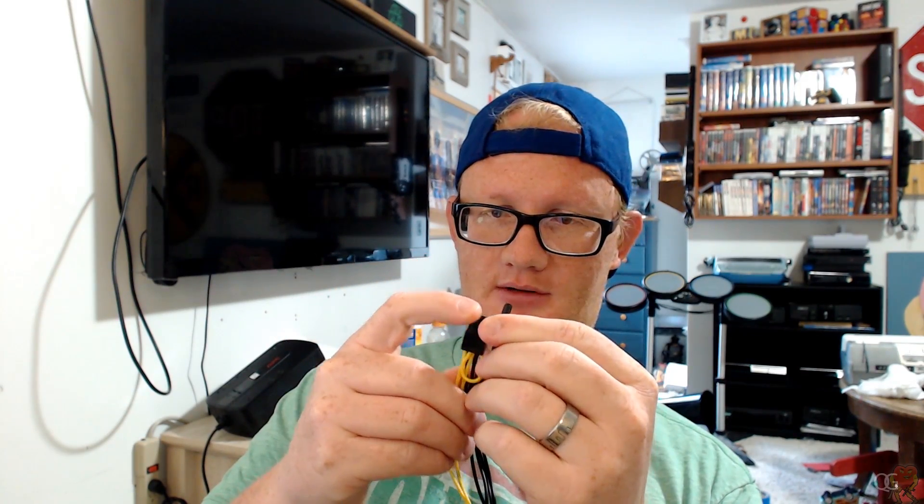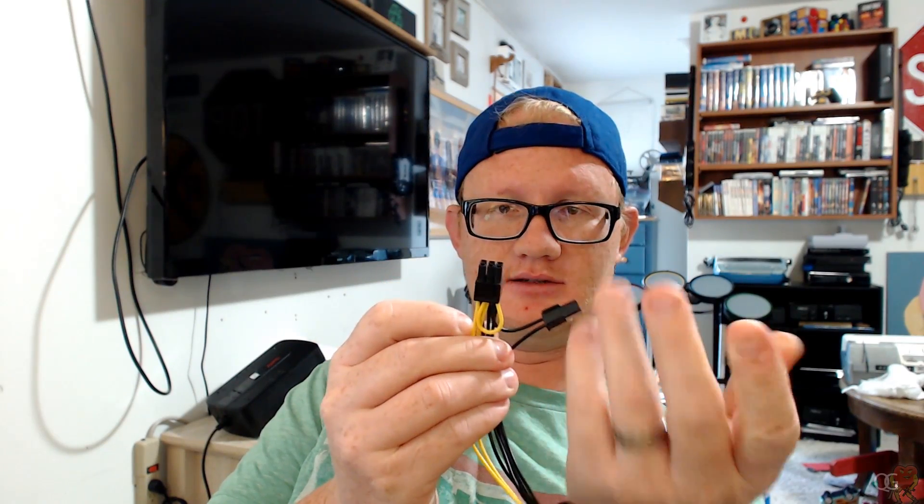It was really frustrating, and I probably won't buy HP because of that — every computer I've bought since 2006 has been HP, and that just did it for me. Until the other day when I found this little cable. On one end is a SATA power cable — a male end that plugs into the female SATA power cable coming from the power supply on almost every computer nowadays. The other end is a little 8-pin graphics card connector, or if you have a 6-pin power port on your card, you can use just the 6-pin portion.